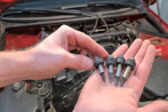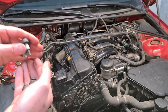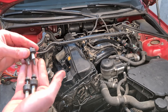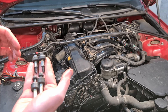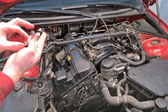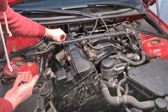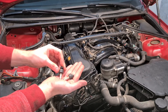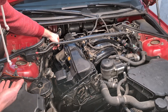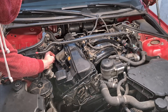Here you can see we have different lengths. If you mix up the bolts you may risk damaging the cylinder head because you will try to tighten down the bolts into the wrong hole. You might even have an oil leak because the bolts don't press all the way down to the appropriate distance. This is a very common issue on these engines. The shortest bolts go here at the top, the longest bolts go here, and the rest of the bolts all have the same length — put them all around the edges of the cover.